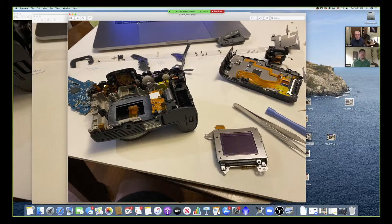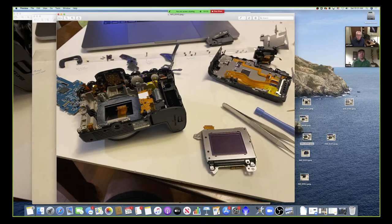This was camera 13 modification, and Brent sent me some pictures during surgery. This is deep into the surgery. You basically have to take the camera apart — you take off the back, you take off the main board, there are ribbon cables you have to disconnect. There's a fair number of screws, but keeping track of where they go, it's pretty easy to put them all back together.